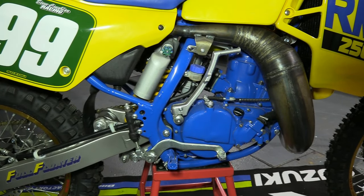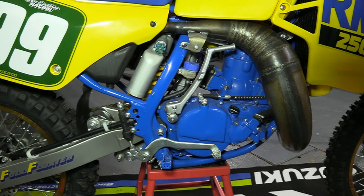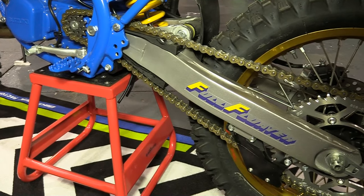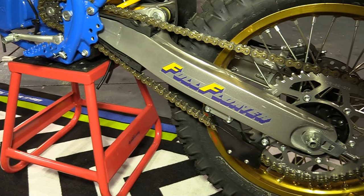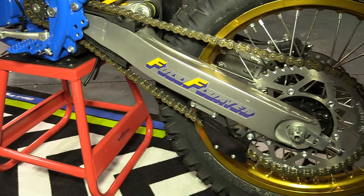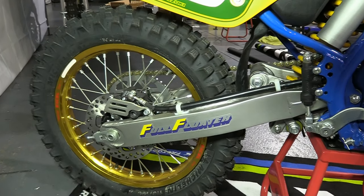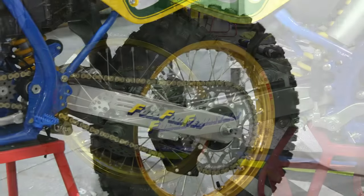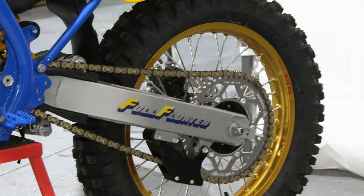At the back of the bike, it was a hard-anodized piggyback Kayaba single monoshock that, as I remember, had a kind of dual valve staging system inside the shock. The outer spring was certainly a lot heavier and stiffer than what was fitted to the earlier 87 RM. That Kayaba shock was connected through a linkage onto the Suzuki's full floater swingarm setup at the back. For 1988, the RM's full floater swingarm and single shock arrangement was about as good as it got in that year, and motocross bike testers of the day still have Suzuki's full floater suspension listed as one of the best rear suspension setups of that year, handling bumpy tracks with relative ease and providing good feedback for the rider.